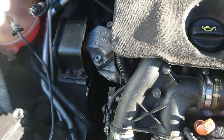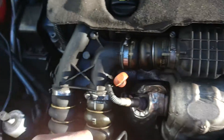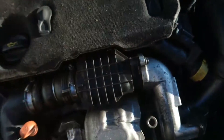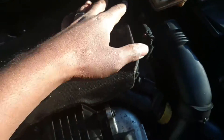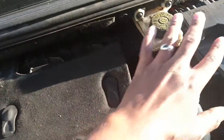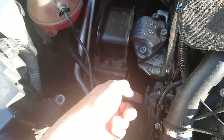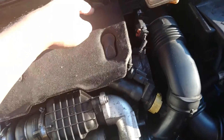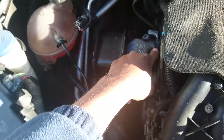The EGR is hidden at the back of the engine. Normally it would be on this side, but Citroen decided to put it on the other side. To take it out you basically have to dismantle the whole thing. You can take off the wipers and all the stuff to remove this filter, or you can just lower the engine — put the jack underneath, lower the engine down, then remove the filter. It will not come out without the engine or this whole part being moved, so I'm going to lower the engine by removing three bolts.